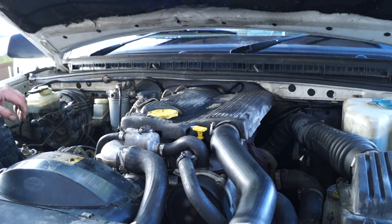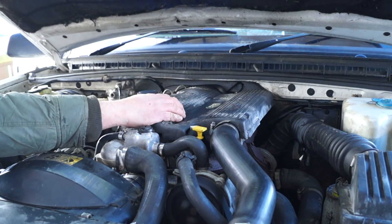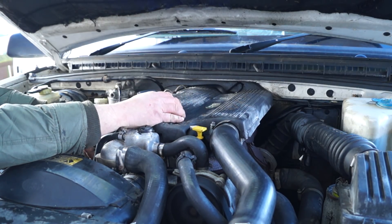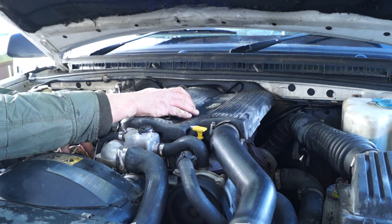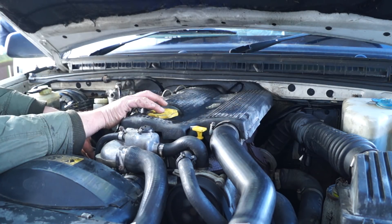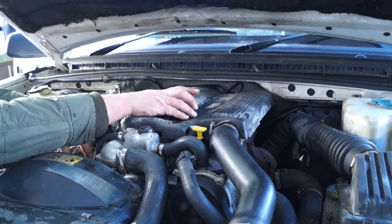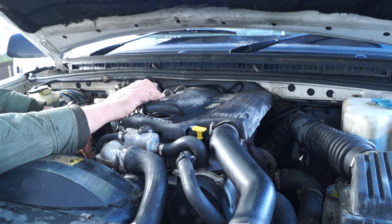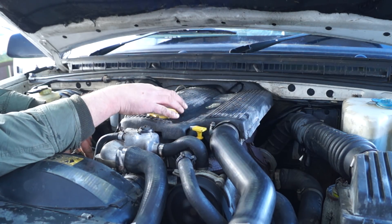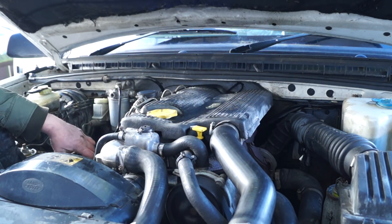The quick test just to check how much crankcase pressure you could actually be having: just lift the oil filler cap off and see if there's any pressure there. If there's a considerable loss, it'll come through at the top here. Rev it up a bit, just hold the cap on loosely — if that wants to come off, then you know you've got pressure there. It doesn't seem to be any at all, so it's okay. Actually this engine isn't too bad — it's getting worn but it's not the end of its life, just tired.